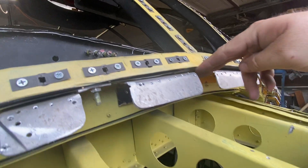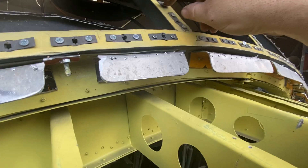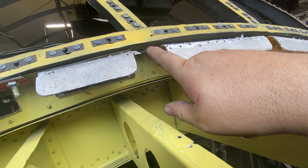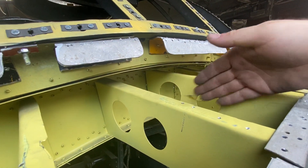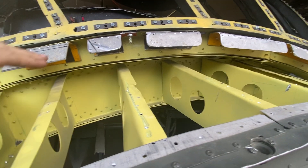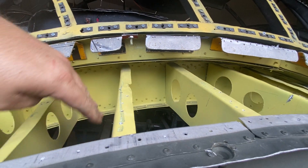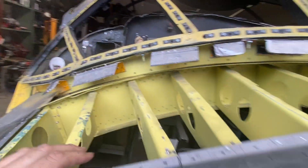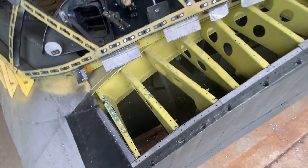I assumed that these big thick heavy frames continue down here and catch one of these stringers like they do on the aft end. But it's different up here — they've actually got big pieces of either thick aluminum or thick steel that rivet in on the inside, which I'll have to cut into right there. Then with fasteners going through here that will continue down and attach to these stringers. The reason for those really wacky and crazily angled stringers is to pick these guys up, so this will have to be de-riveted and one put in here that goes like this, so this surface can mount to it.